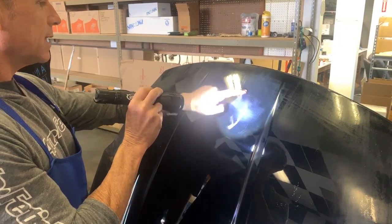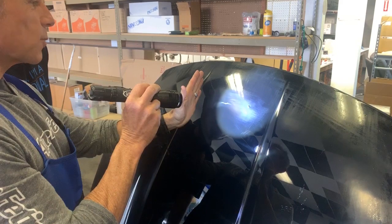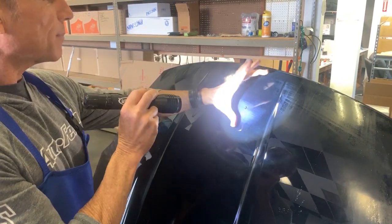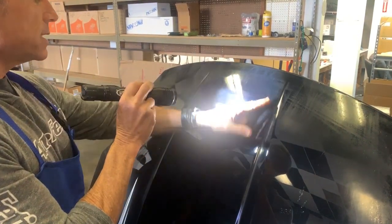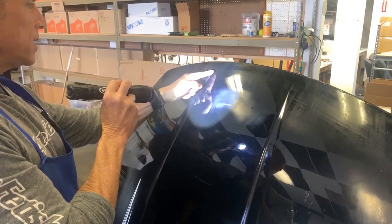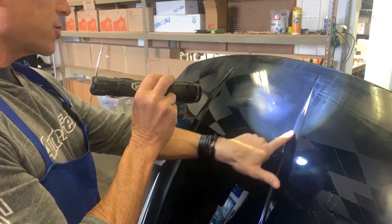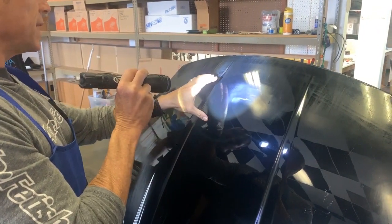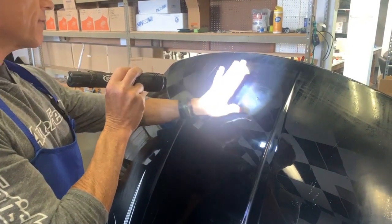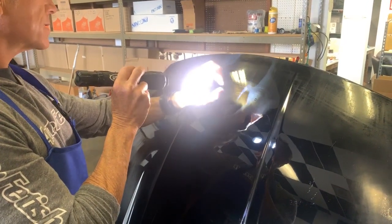What you need to be aware of is that your sanding marks run like this, so your pad — which is approximately this size — is going to be overlapping that area so you can remove the marks in this tighter zone. You also need to be aware of what's called a character line here and here — those are your vulnerable areas, where friction will build up more than on a flat area where the friction of the entire pad is dispersed over a larger area.